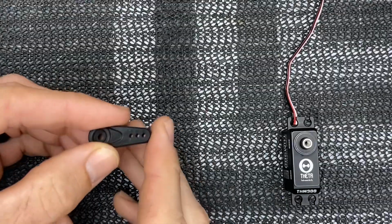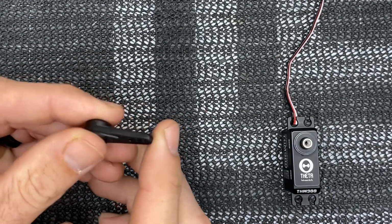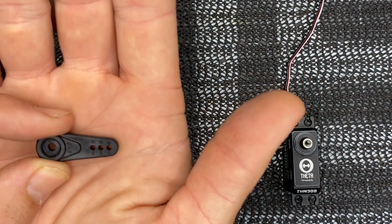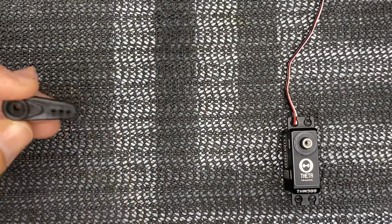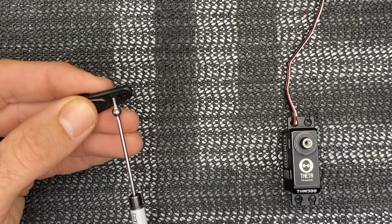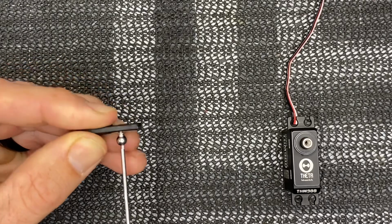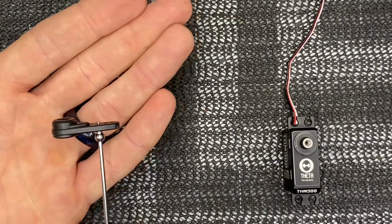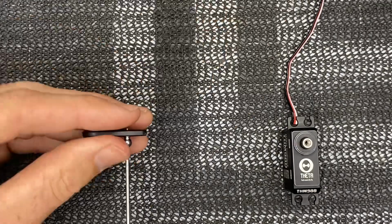So now we are gonna move on to getting our servo horns ready to be installed. We are running the SAB servo horns, and they have little marks here that say all of the sizes, 15, 18, and 21. You want 15 millimeters from the center hole to your ball. On these particular servos, they're nice and thick on these horns, so we're gonna go to the 15 mark, get our ball started, tighten it all the way down, and be careful not to over-tighten. If you wanna use a drop of CA, you can as a thread lock or a nut on the backside. Since this doesn't stick out far enough, we will use a drop of CA.